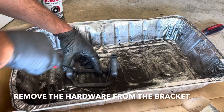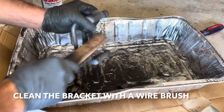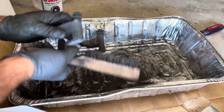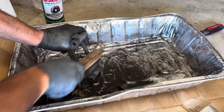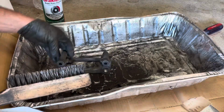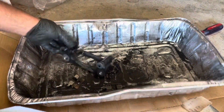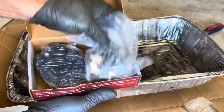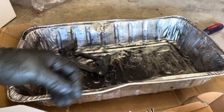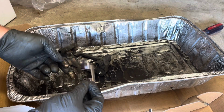All right, guys, remove the clips, and wire wheel where the clips were. All right. This is a part number for the pads, and they come with new hardware. So just match up the hardware that was there, and something like that, and then just put them back in.